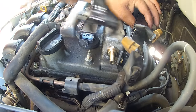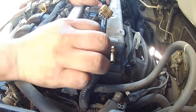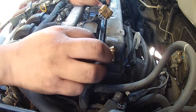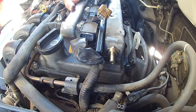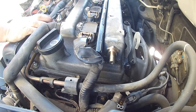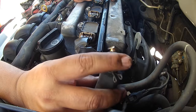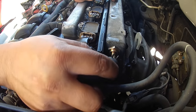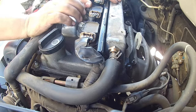We're going to start this by hand. Now bring the wiring harness back over here, bring in your nut and the bolt. Tighten this one down — just snug it up — and tighten the bolt here. Bring back in your connectors for your coil packs, make sure you hear that click. All those are in place. The new PCV valve is in place. Bring your hose back in — if you're having a hard time getting the hose on, you can put a little bit of WD-40 or grease in there. That is how you replace the positive crankcase ventilation valve on a 2002, 2003, 2004 Toyota Corolla, Matrix, or Pontiac Vibe with this 1.8L engine.